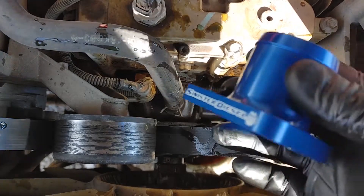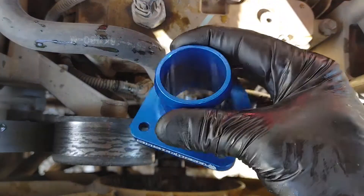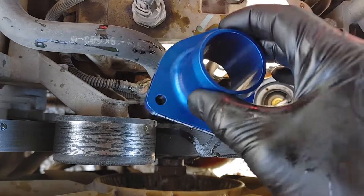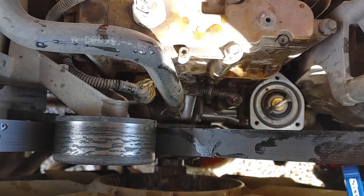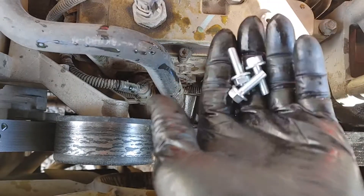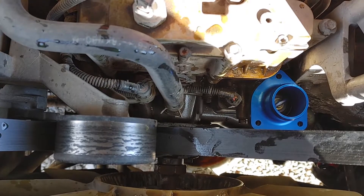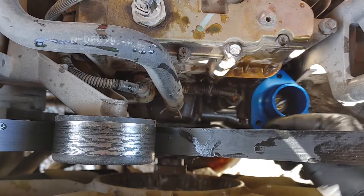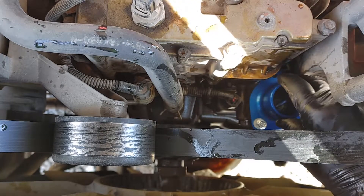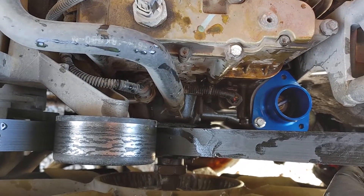Pièce de résistance. Like I said, I think the OEM-style steel housing is fine, but this aluminum unit is a nice piece. I just got tired of screwing with this. I think just the thermostat itself would have fixed it. It comes with new flange head bolts. I'm going to grab a couple of washers so I don't gall the aluminum. I even lubed them up with a little bit of PTFE — Teflon lubricant. The only reason I did that is to allow the metal to slip on the washer and keep it from digging in and dragging on the aluminum.